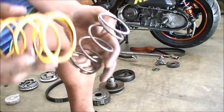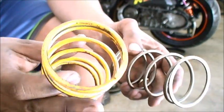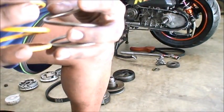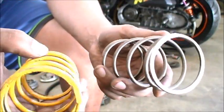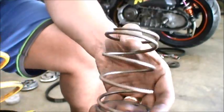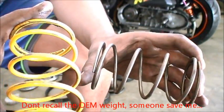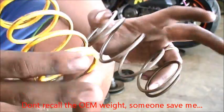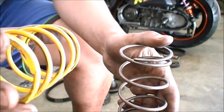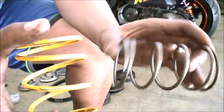The next part of the torque driver is the torque spring. This is a 1,500 RPM spring — I think it's a little bit thinner than the OEM spring. What it does is control how fast or how long you stay in the gear you're in. This one is also good for hills and provides more uniform acceleration over the OEM spring.